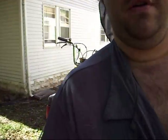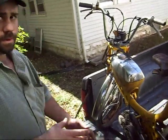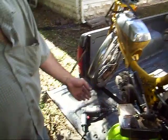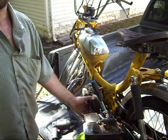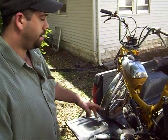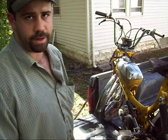So we're going to have him fire it up — he's been working on it since yesterday. When I first brought it home, there's a cover that goes right here, and it was full of water and all this was rusted. The points were rusted, everything was rusted. But I cleaned all that up, got the points loosened up and cleaned them. I've got the timing half set but I haven't really got into it yet.